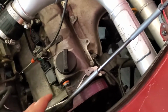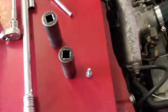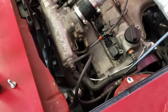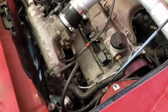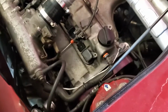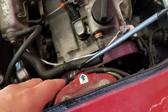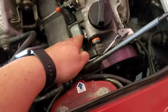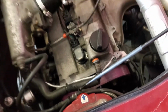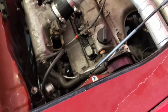So put the engine at cylinder 1 top dead center. I did get a piston stop just to make sure. It is a used engine, it may be off just slightly, so I got a piston stop. I'll make sure that mechanically the timing is set, so that we're on the compression stroke on cylinder number 1, top dead center. I'll compare it to the factory marks, and if it's off, it's off. I'll make a new mark, and we'll go off of that one.